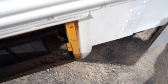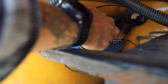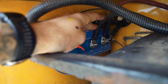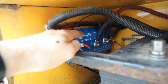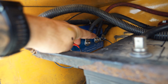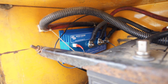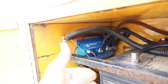Back where all the magic is. This is output 2, this is output 1, and the input is right there. The input comes from the alternator, output 1 goes to our solar batteries, and output 2 goes to the bus batteries. Basically this device activates when the engine is on due to the energize wire, and then it charges the bus batteries and the solar batteries simultaneously, ensuring that one set of batteries cannot drain the other. So far it has been working perfectly.